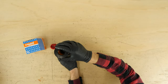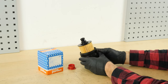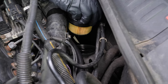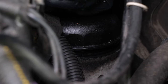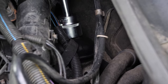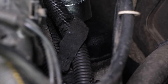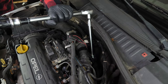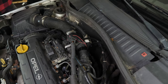Insert the new filter into the flange — you must hear a click to confirm it has been locked into place. Screw the filter by hand until it makes contact. To fix it in place, use the socket wrench, the extender, and the filter wrench. Be careful: with this kind of oil filter, the new joints can be excessively thick, making the tightening process more complicated. Ensure that the flange washer is flat against the oil filter housing. For this step, you can also use a torque wrench set to 25 Nm.